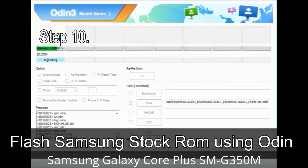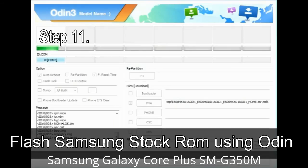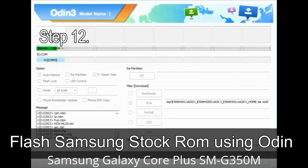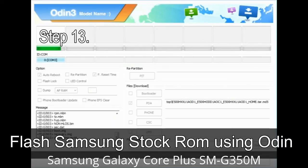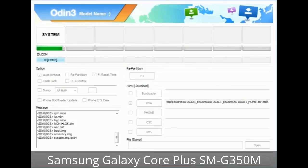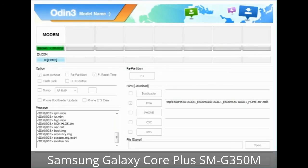Step 10: Click the Start button in Odin to begin the flashing process. Step 11: Once you see the green PASS message, remove the USB cable from the device. During this process your device will restart automatically. Step 12: Your Samsung device may get stuck at boot — boot loop. Step 13: Boot into stock recovery mode by pressing and holding the Volume Up key, Home key, and Power key. When the phone vibrates, leave the Power key but keep holding Volume Up and Home — you will boot into recovery mode. Step 14: In recovery mode, wipe data / factory reset. Step 15: Once cache data is cleared, select 'Restart phone now' from the recovery menu. Your Samsung device will restart without any issue with the stock ROM you downloaded.